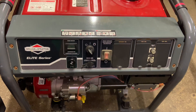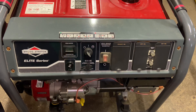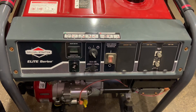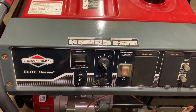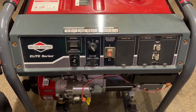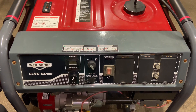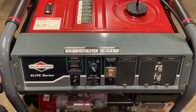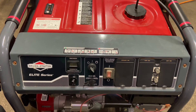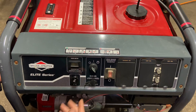The reason I left this thing run is because it was actually hunting up and down. I was hoping it would stop surging — it does take a little bit of time. This is just pertaining to this machine; these carburetors have tight tolerances and you need to let them warm up. You do not want a generator to surge when you're using it because you'll get a surge coming out of the generator that powers your house. We have a lot of issues with generators coming in here because they surge or hunt up and down — it's because we don't use them a lot and we end up having to rebuild or replace the carburetors. If it does not smooth out after five minutes of running, you can compensate by pulling the choke out a little bit while it warms up.